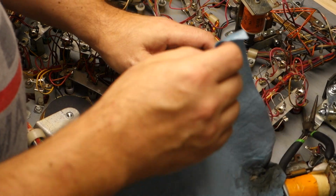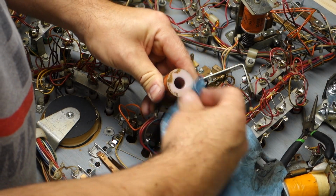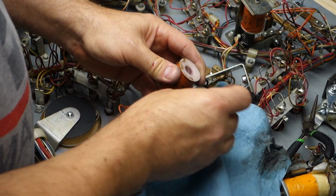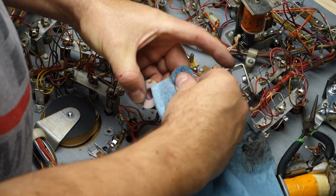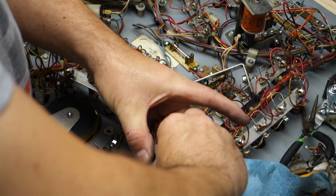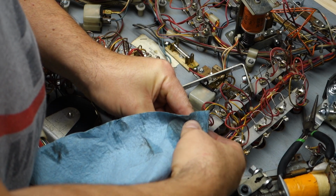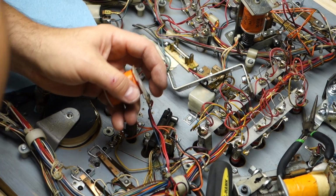I use naphtha out of this little container because I don't recontaminate my supply by dumping it on my towel and shaking the can on my towel. I see a lot of people that do that. So if I put it in a separate container and use an eyedropper and just drop what I need on it, I get the precise amount I want and it stays uncontaminated. I'm not messing with a giant can. And that is some baked on junk that we're not going to worry about.